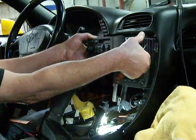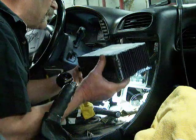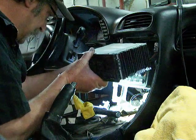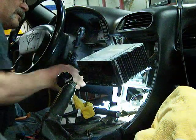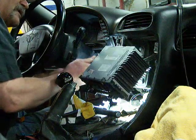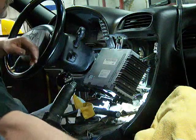There, like that. Be gentle - there's an antenna wire you're going to have to undo. Be careful with it because replacing it would cost money. Having small fingers would be handy at this point. I have a hose removal tool I'm using here - I'm just going to grab the antenna on the metal part that way so I don't mess it up. It's only for hoses really, but I use it to open electrical connectors.